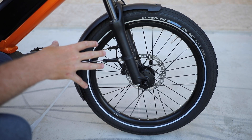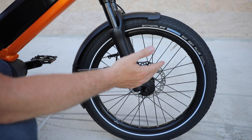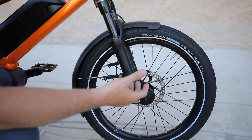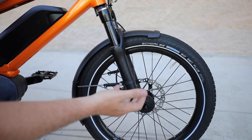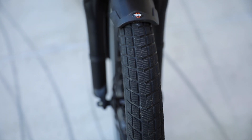Starting with the front of the bike, you can see it's a relatively small wheel — a 20-inch by 2.15. This is a Schwalbe Big Ben Plus. Schwalbe makes a variety of tires, and this tire is specifically rated for e-bikes. It's the Plus tire, so it has extra puncture protection, and it's also what's called a balloon tire. Because it's a balloon tire, it's able to run at a slightly lower tire pressure, which gives you a lot of added comfort as well as additional traction. This tire is good for an urban environment, and if you're going to do a little bit off-road, it'll work well also. For rougher trails, you might want something with a little bit more tread.